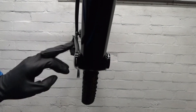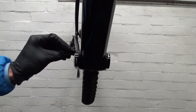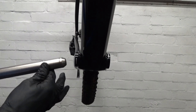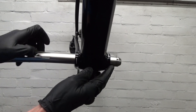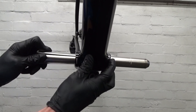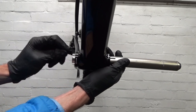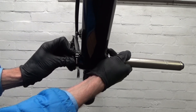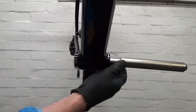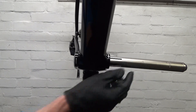First I'm going to remove the drive side cup — the right hand side one when you're sat on the bike. I'll put the tool through; being such a tight fit it'll stop there. Then all we do is squeeze up the end and pull it through until it just goes in behind the cup, and it'll spring out. That's a perfect tight fit in there. Then we get a soft blow hammer and hit the opposite end to knock it out.